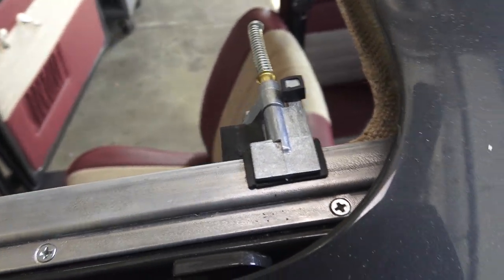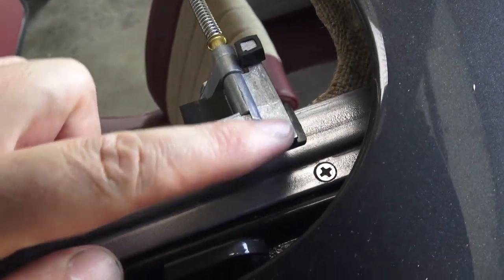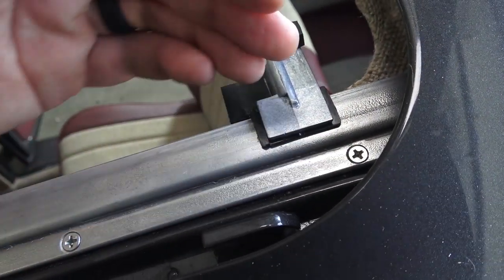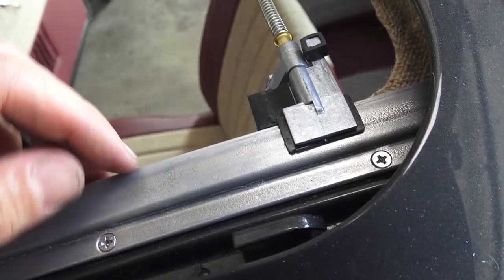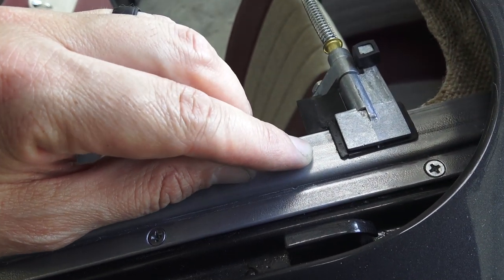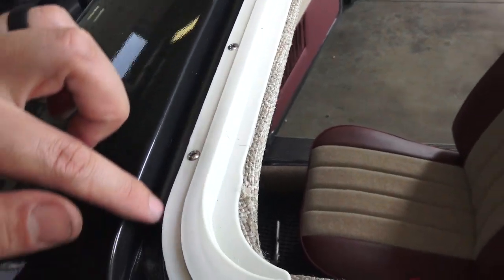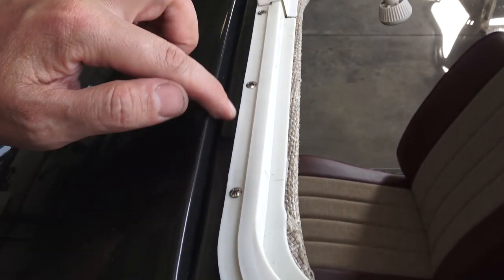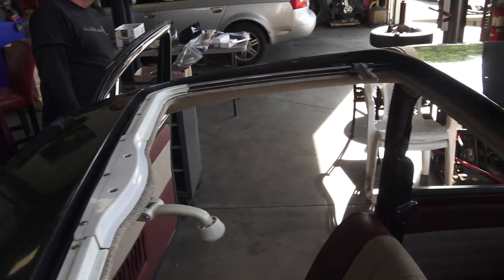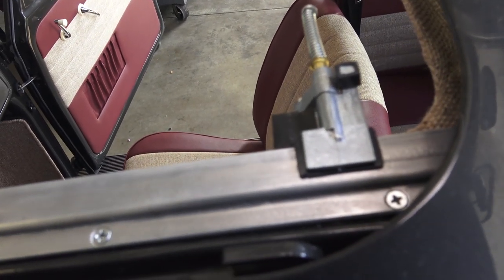Again, this is where we position the sliders — screw to the corner of the slider. But we'll need to adjust that, moving it forward about a half inch, because when we put the roof in it wasn't even with the opening. Take the plastic pieces off again and reposition the cables, similar to what we showed in the previous two chapters.